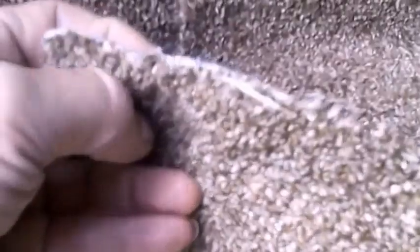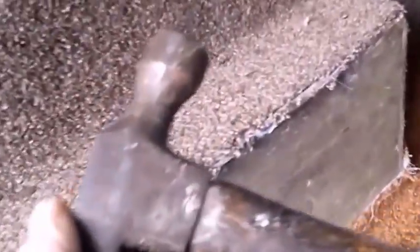Where the wheel arch is, I still have a section waiting to go on there. This is a section of the wheel arch, the last bit to carpet on this side. With this section of carpet, I'm going to make a fold in the top so it fits in something like that, and then I'll just tack it in place. But first, with that fold, I'll still need to glue it down, and then just hammer and tacks to get that fold to cover up this edge here.